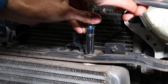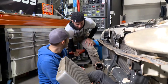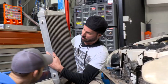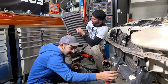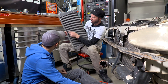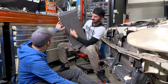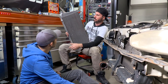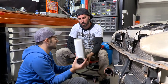It will be replaced with another hacked-up bumper later on, and then the massive intercooler can also be removed — that's enormous. The back of it had rubbed through because someone put a bit of hose and a cable tie there, and the cable tie and hose rubbed through the cooler. It's a 76mm thick cooler — way too big.